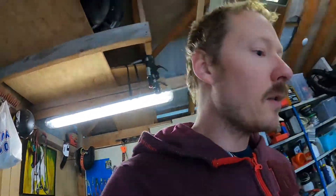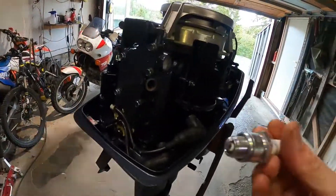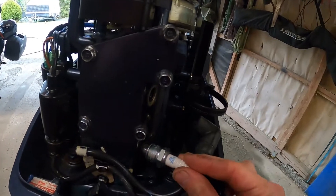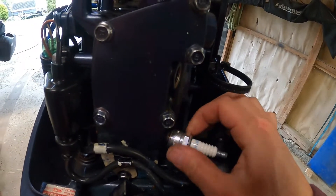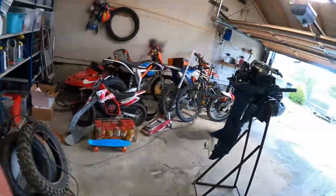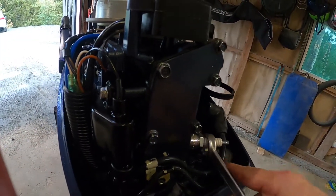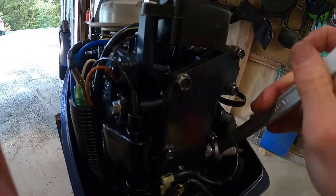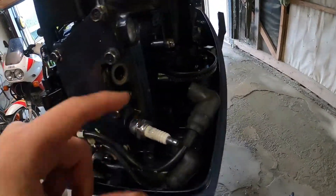We're gonna have a lot of reviews on this thing — how to make old engines run, and if you can make them work, why not? It's perfect. So we got some new spark plugs — gonna go ahead and fit those. The gap looks about right. The old ones were a little dirty, which is to be expected. When you do the spark plugs, tighten hand-tight and then go about 90 degrees. Don't overdo it — so many people strip their threads.